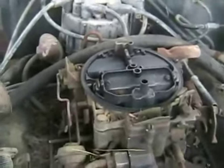So let's rebend the rod to a correct position so that the choke only opens up about that much, and let's see if it'll start and keep running this time. Nothing has been touched since the last video. Okay, choke is in the correct position for a cold motor.